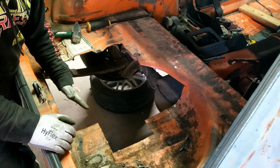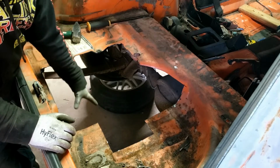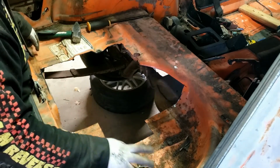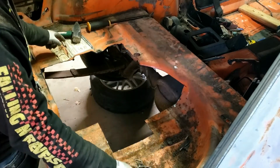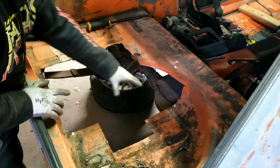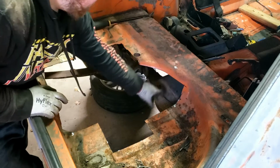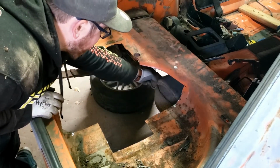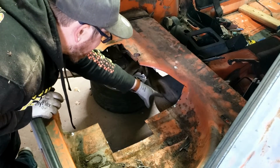So basically my plan of attack for this whole area is that I'm going to place the fuel cell in here. Like I said, I'll put this bar across the back, and I think I'm just going to get another one and put it across the front, so I'll have two of the same ones in the front and the back. Then my fittings sit right here, right in front of the rear end. And my pump, I can actually see it right there, is going to have a quick little line to go from the feed here over to the pump there.